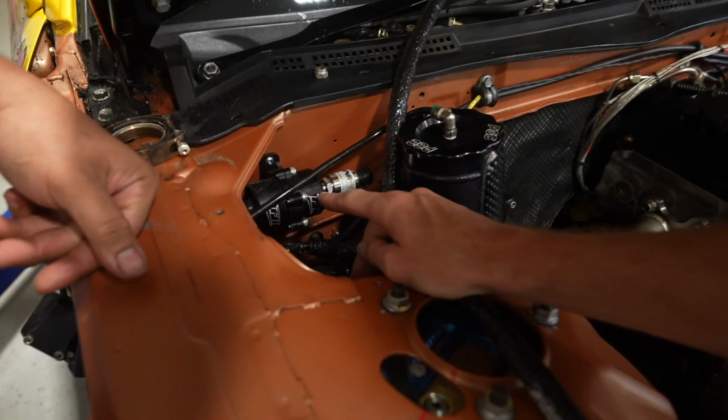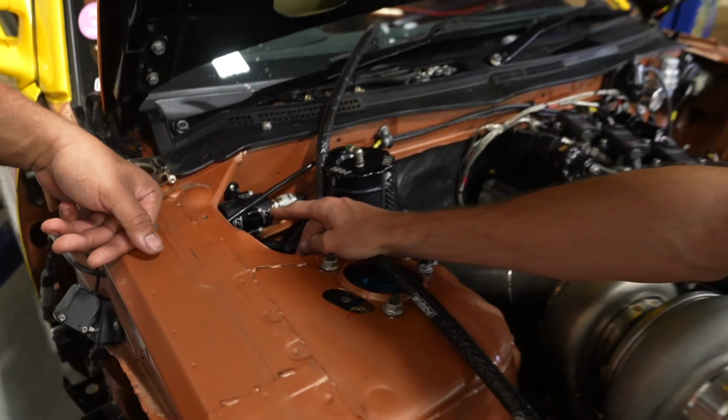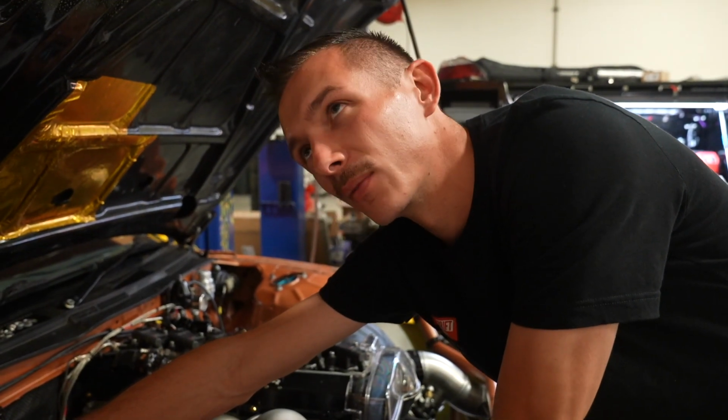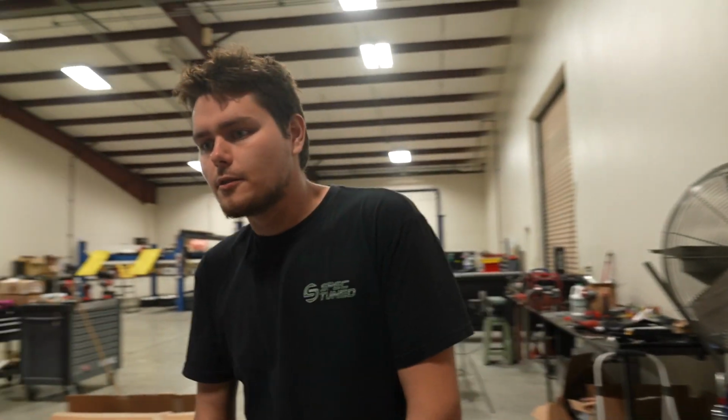This canister we've shown kind of like a similar setup. I believe we had, was it on the E36 when we were testing? One of the cars we had one on. No, I've never made it on that. Well, I guess maybe it was on this, but we had a more rudimentary version at first. But anyway, that basically tells us what the pressure is. There's like a coil that diffuses the heat so it's not super hot, and then smooths the pulses out of the manifold, right? So that's what that canister does. It smooths the cylinder pulses down.